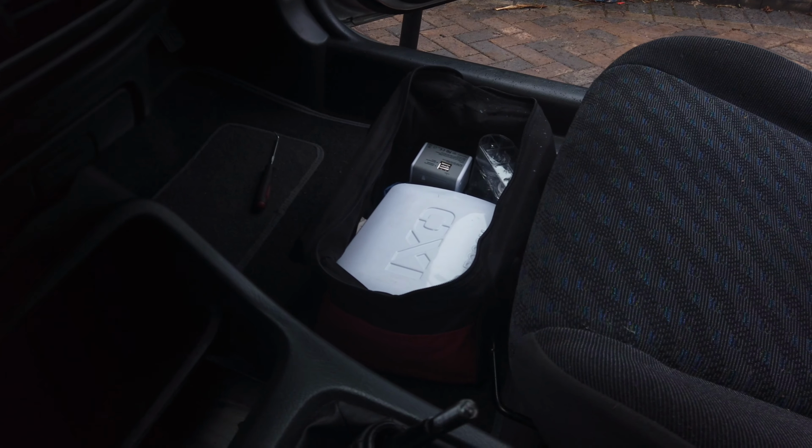Yeah, definitely. Let me do the handbrake tensioner up. So we'll just go until it's on like four clicks, right, and then locked out. Okay. That's whereabouts it should be. Obviously you don't want to go too much because then it actually locks up on the drums. Oh, okay. So, cool deals.